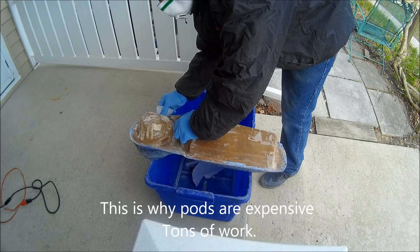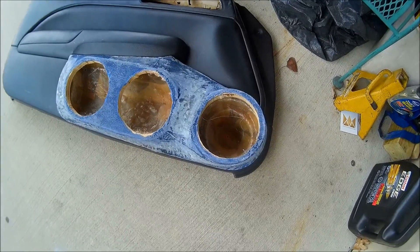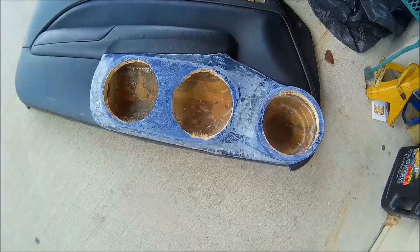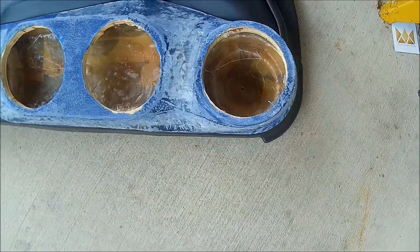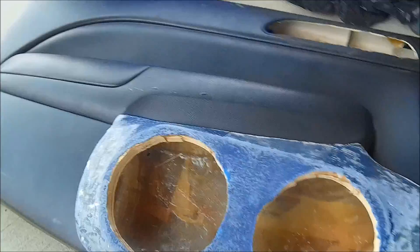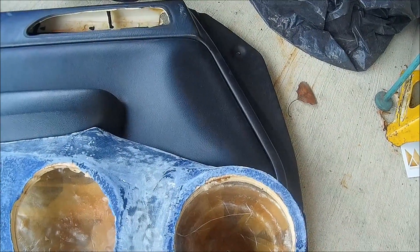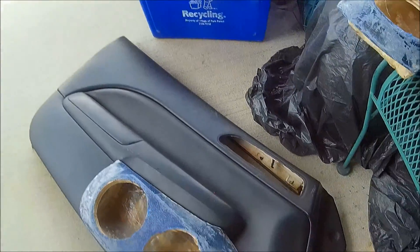Dropping out here. Alright, so this is where I'm at with it — that's what it's looking like. What I plan on doing is mounting it to the door. I got a hole right there, another one up top, one more right here, and there should be one more in the upper corner. Mount it to the door using bolts and nylon lock washers. Then masking this off, laying my reinforced fiberglass filler in there, setting it down, knocking it out — and that's gonna make a perfect fit.